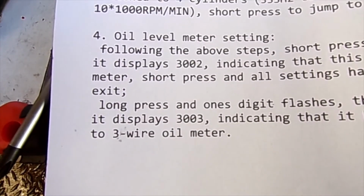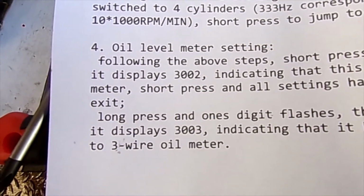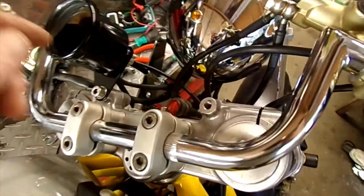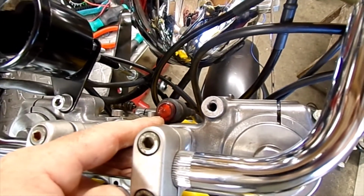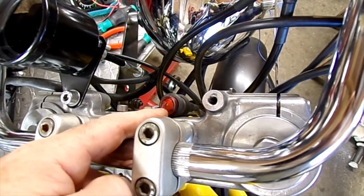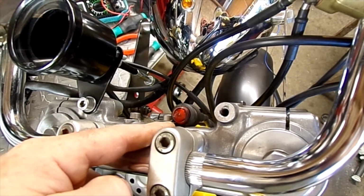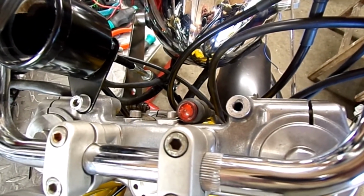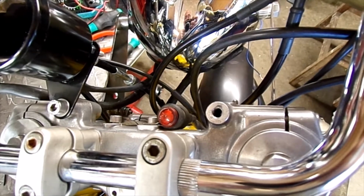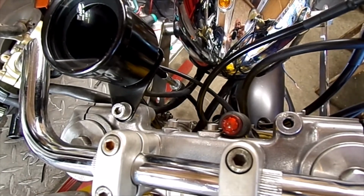I'm going to assume that they've got oil and fuel mixed up, and that it's actually a fuel level gauge, which, let's say, on the Ducati all there is is a low level warning light. There is no level meter. It just lights up when it's low. So if I wire it into that or tee it into that, I'm not quite sure how that will work, or whether it will do anything. So yeah, not sure what to do with that. I might just go ahead and set this bit up and then worry about that later.